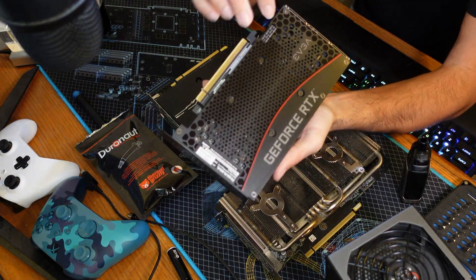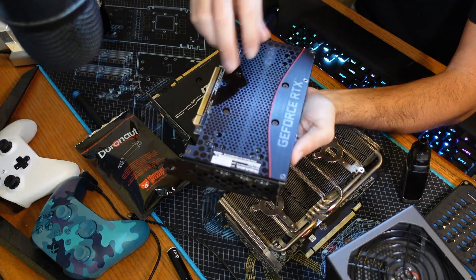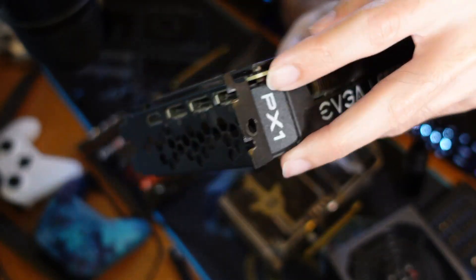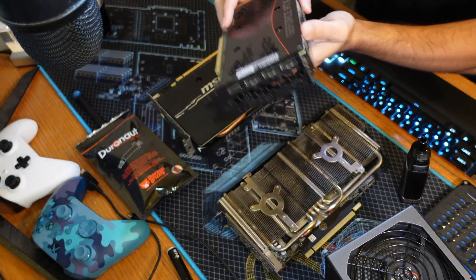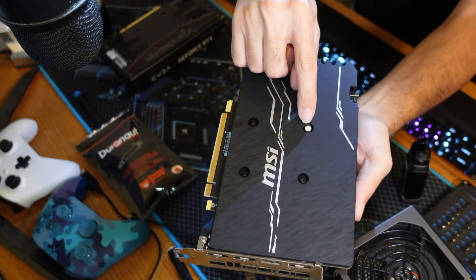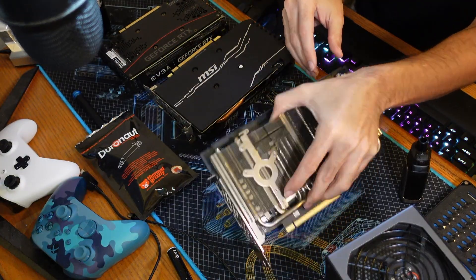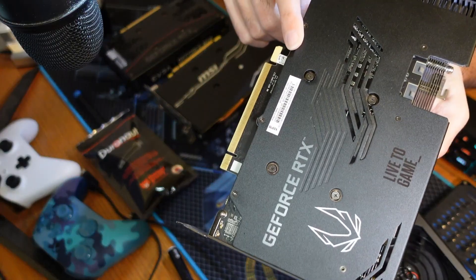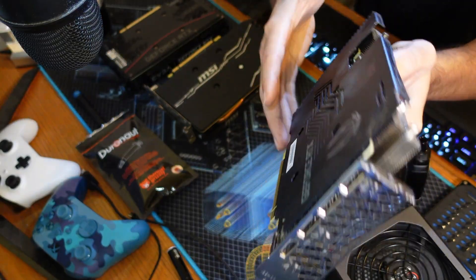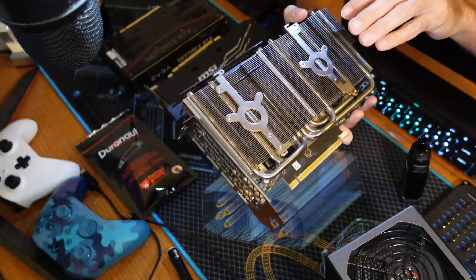To tear these down is very simple — that's one thing I love about these GPUs. You have your four main screws around the core, and then on the EVGA one here's a backplate screw, another backplate screw, and two more towards the front. Be careful with the ones towards the front because there's a little nut on the back side — you don't want to lose that, otherwise you can't push the backplate down. On the Zotac, it's kind of the same thing. Those holes on the outside that look like screw holes aren't — they're actually the back side of nuts that screws go into.